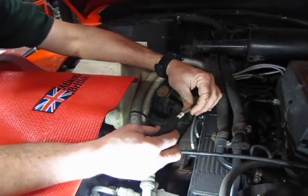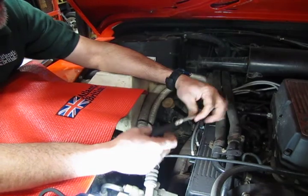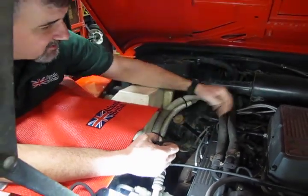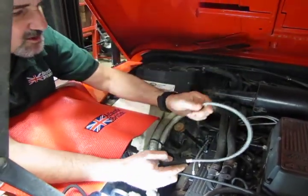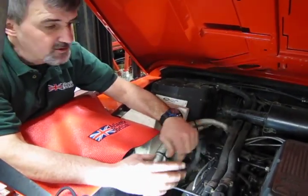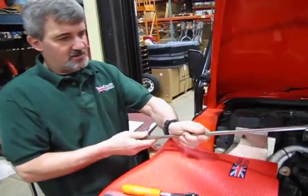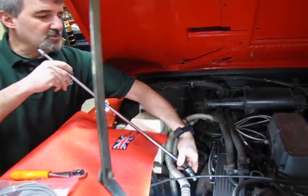When you take this apart, doing one at a time, you can remove your spark plug — you know what number cylinder you have. Trace your wire back, there's your location on the coil, remove that one wire, and then when you're done changing the spark plug, reinstall your new wire with that corresponding number, and then just do each one all the way around. We have our 13/16 swivel head socket, long extension — our spark plug is off, and our spark plug wire.